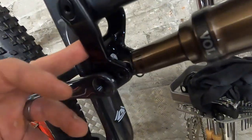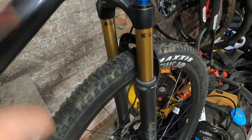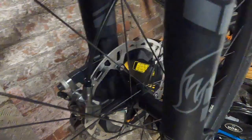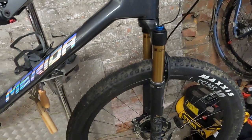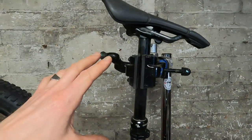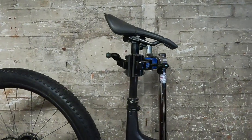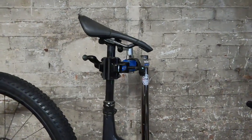You've got a nice carbon rocker moulded in one piece, then a Fox Factory shock on the rear and a Fox Factory SC32 fork on the front — the lightest fork Fox make, with the cutaway on the inside to save weight. It brings the crown in narrower, so tyre clearance is fairly limited on the front, but most people are still perfectly happy with a 2.25. There's also a Fox Transfer dropper post; its listed travel is 150mm but the actual post is 170mm, so I'm right down on the collar on this 477mm seat tube — a hell of a drop for a cross-country bike, more than enough to get yourself low and dynamic for technical sections.